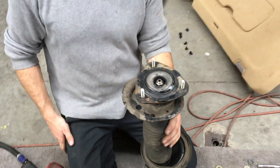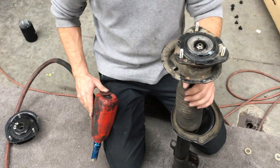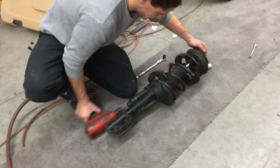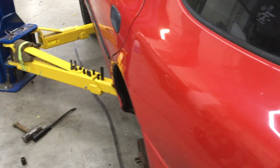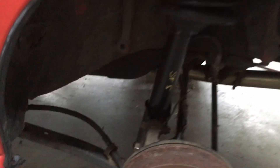Now we've got no wobble. Cool - troubleshooting to get this thing to work. So you're gonna need some washers. Use some washers if you want to use the stock top hats. If not, you can drill new holes and just use the Forester top hats - you just have to match up the holes because these are different. You just have to drill new holes in the strut tower. This is way easier - two washers and you're good.